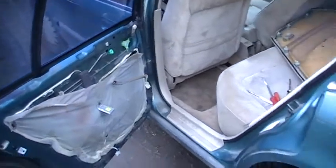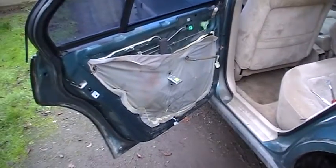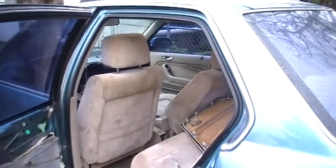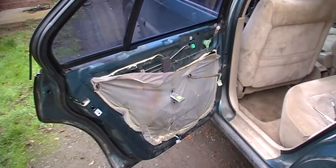So at this point you've got your door panel off. When you go to put it back on, if you're going to do some work on it — this video is mainly to show you how to get that door panel off. The vapor barrier is pretty important, especially in a wet environment. Just duct tape it back if you have to — you could even get a sheet of plastic and cut something out. I used to just leave them off but now I find it's more and more important to put those on, because if that vapor barrier is missing the water leaks in and causes the carpet to separate from the side panels. That's it for how to take your door panel off. If you have any questions please leave them in the comments and I'll try to answer them. If you like this video hit like, and if you want to see more like this hit subscribe. Thank you for watching.